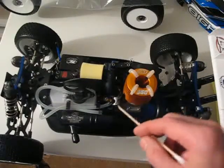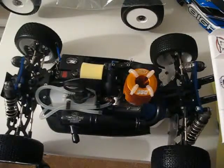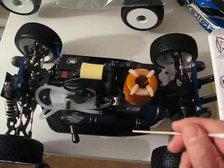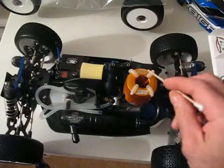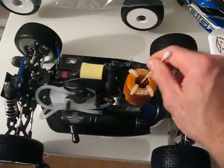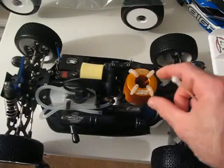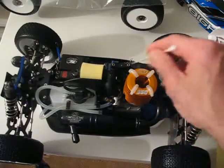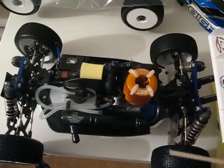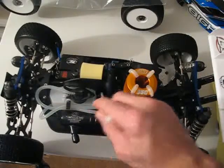These cars will start fairly easily with a pull start and drill start when you're breaking them in. The hardest way to start them during break-in is using a bump box because the rubber wheel will slip on the flywheel — the flywheel will get caught. You usually have to put a screwdriver on the flywheel to move it because it will get stuck only when you're breaking it in. It's always a good idea to put some run-after oil down inside the engine before you break it in. Put your glow plug in and don't fully tighten it — if you leave it a little loose, it will kill some compression and start easier. You could also wrap the head with a little tin foil and heat it up with a hair dryer, good and hot, before you try starting it. That will loosen everything up and make it start a little easier.